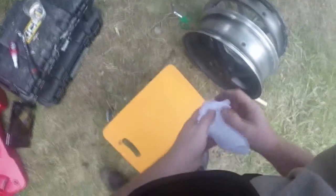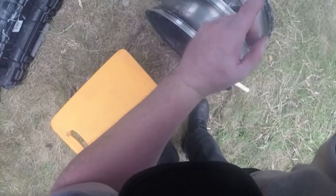And then what we do, without disturbing the water, wash around the edge, the same. And then you leave it for a few minutes and come back to it later on and have a look to see if any of the water has leaked through. If any of the water leaks through to the underside and disappears out there, that means that's not an airtight seal and you need to redo it.